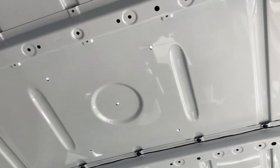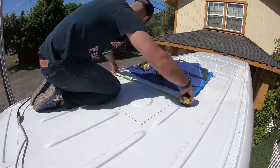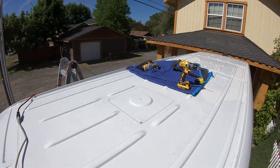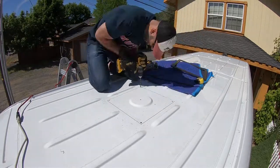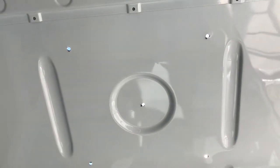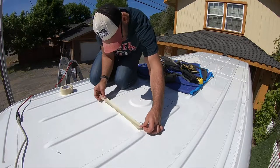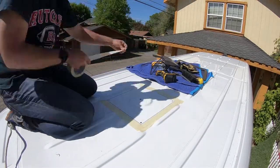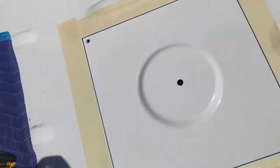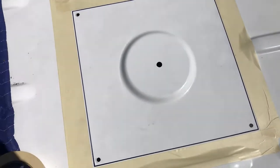So this is what it looks like. The first step for me was cutting four holes in the corners, really close to the corners to make sure everything lines up inside. I did one in the center and all four corners. I'm going to widen those holes now with the step-up bit, then get the jigsaw in there and start going. I also learned from videos online to tape the outside around the edges you're going to be cutting so you don't scratch the roof with the jigsaw, and also to tape the plate on the jigsaw. Tape's cheap, so I'm doing both.